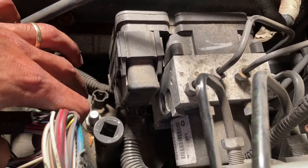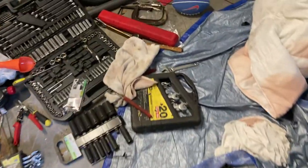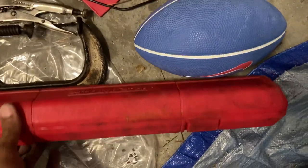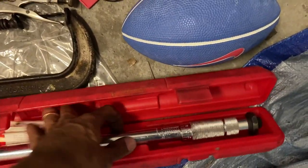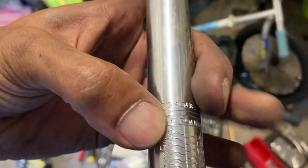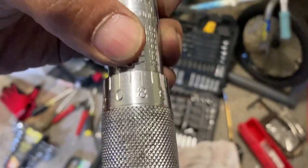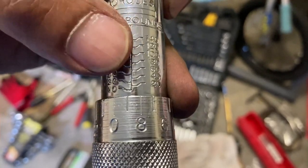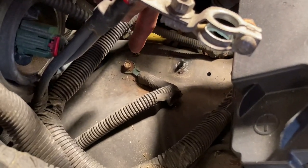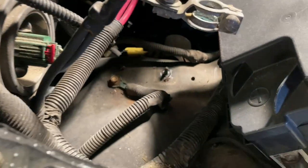So they say that these bolts up here — 18 millimeter strut mounting bolts — take 80 foot-pounds of torque. Let me get my torque wrench here. I'm going to screw it until it says zero, and zero is right here at 80, and I'll torque it and it'll click. One thing I notice is that this ground is looking pretty gnarly — I think I'm going to go ahead and take this bolt off, clean everything nice and good, and maybe clean this ground too while I'm at it, since it's underneath the battery.